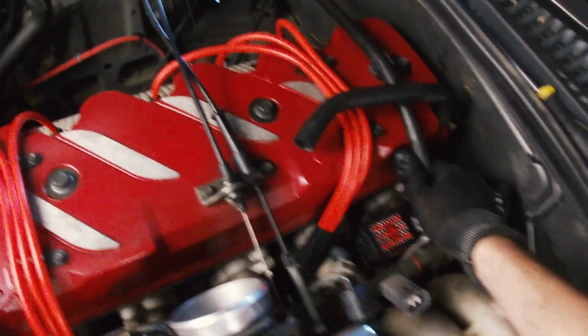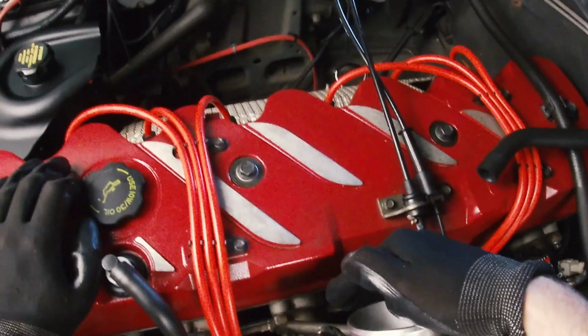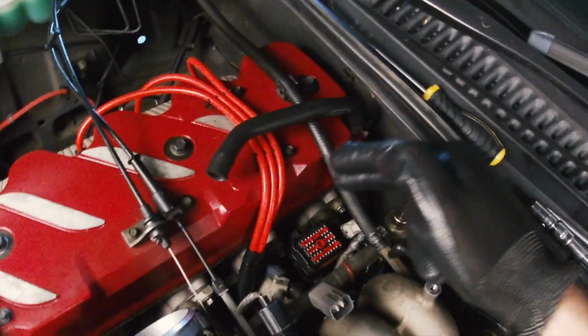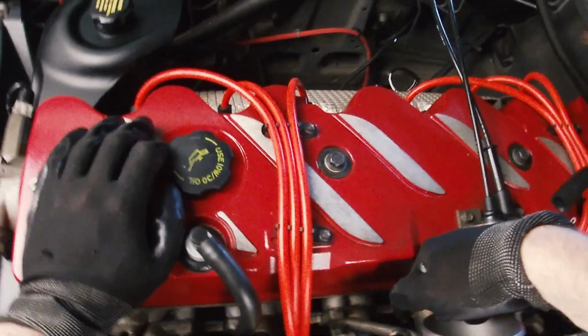I did have a little bit of a hiccup when I got down to the end here because there wasn't actually a spare connector to hook up. I missed a connector, so basically cylinder 4's connector went onto 3, 5 went onto 4, and then 6 went onto 5, and then I didn't have one left. So I had a bit of a look at what the hell was going on, and I found the spare connector down there, so I had to go back, fix it all up.